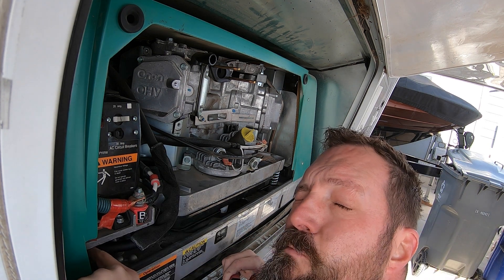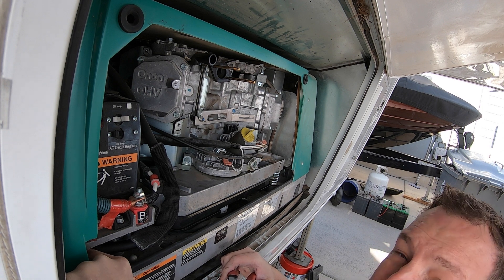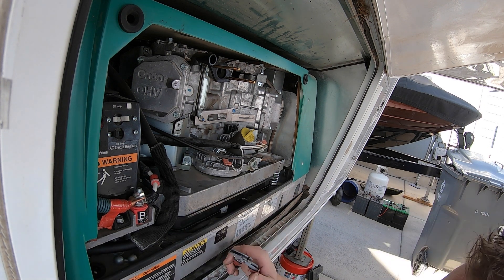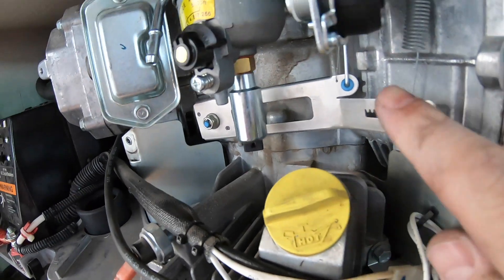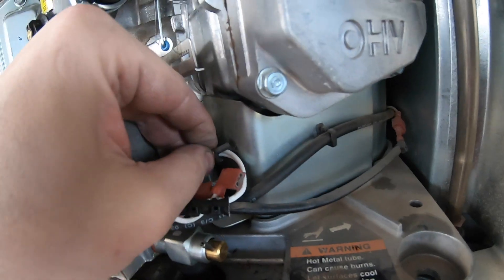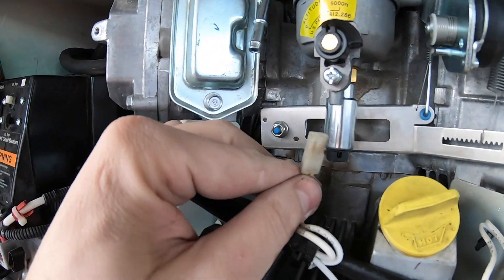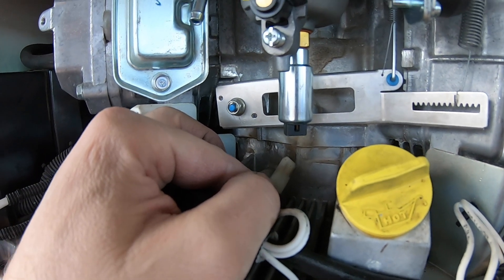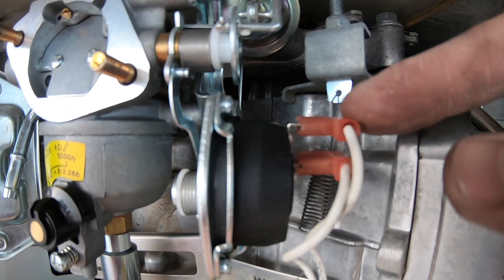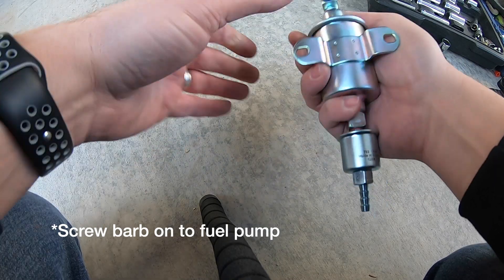As the brazen Brits say on their channel, you need to watch at least six YouTube videos to be an expert — minimum four or something. Well, I watched one. Getting the new carburetor on — this little part was a booger. The choke wires hook up right there, and the fuel line goes on the bottom of the carburetor. The wires only go on one way: there's a small one and a big one so you can't mess those up. Getting it all screwed on and sealed up.